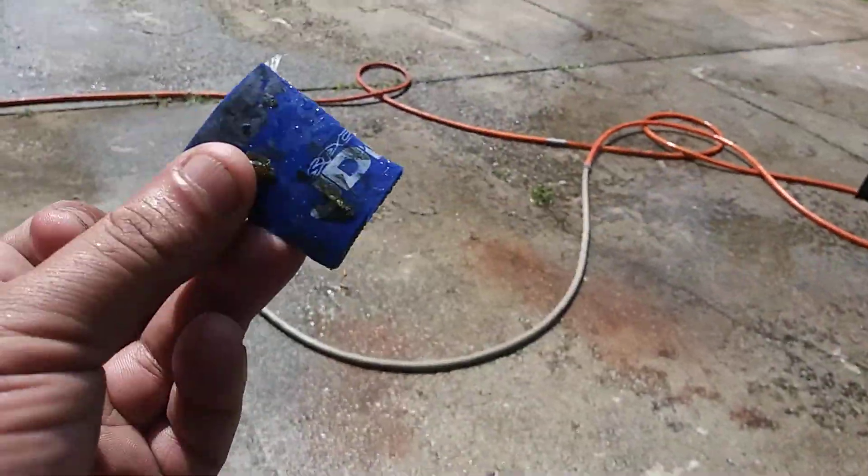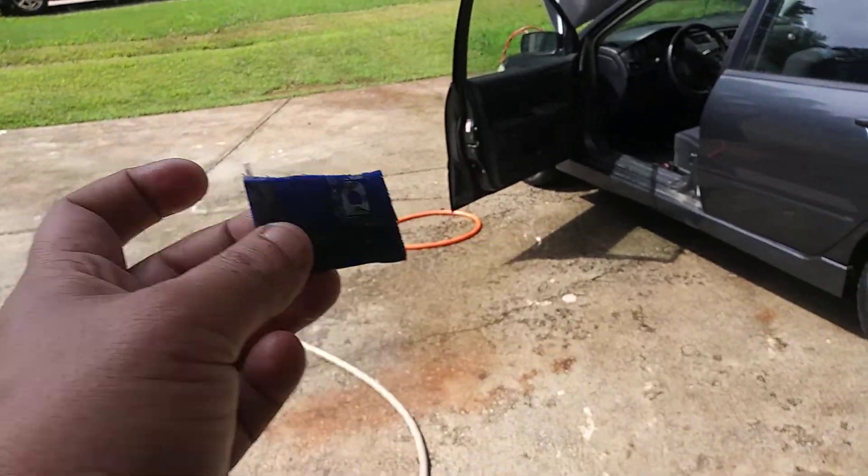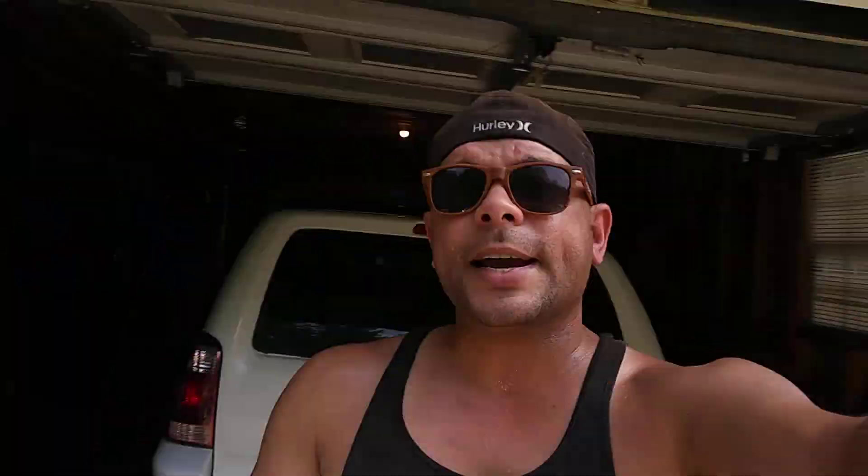I might do something about the motor mount because there's no rubber in there at all. When you put it in reverse it's super smooth, but when you put it in drive the metal hits metal and it vibrates. I took some rubber coupling and stuck two pieces in there just to make sure that was the only issue — and it actually stopped the vibration and everything was good. But with the misfire the motor rocks a little, especially when you hit the gas, and that rubber just fell out. So I might go get a motor mount, which is probably like 10 bucks, and just do away with that.